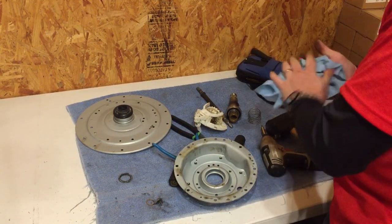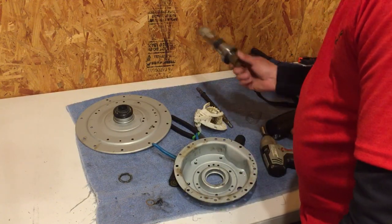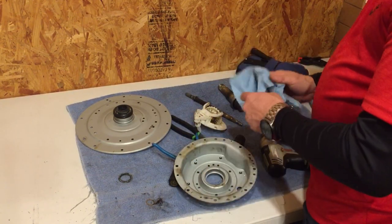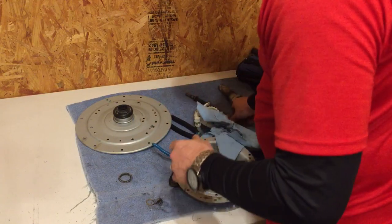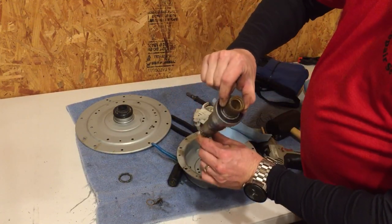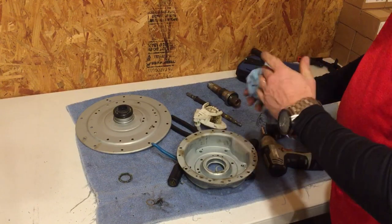So that is it — that's how it works. It's basically just a shaft within a shaft that has a really poor interior bearing. The other two big main bearings were good. The bearing they should have spent a little more money on was the interior one. The tub seal didn't go out — there was a seal internally in here and it was leaking through the shaft. As you can see, the inside of the shaft is just full of rust, so you can tell it's been leaking. It shouldn't rust like that. Alright guys, subscribe and like.